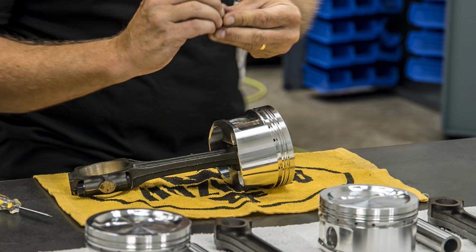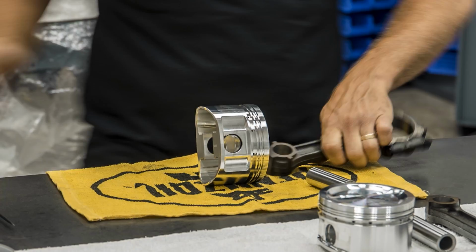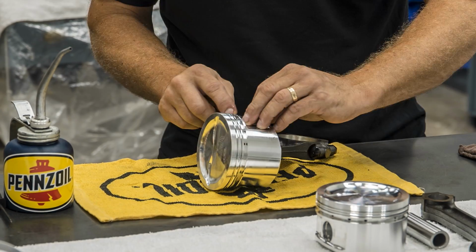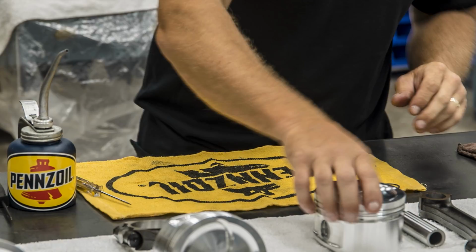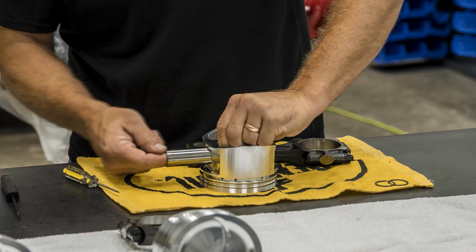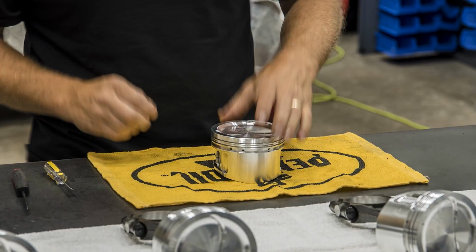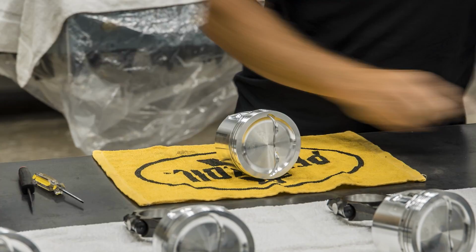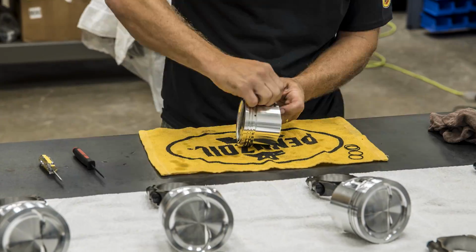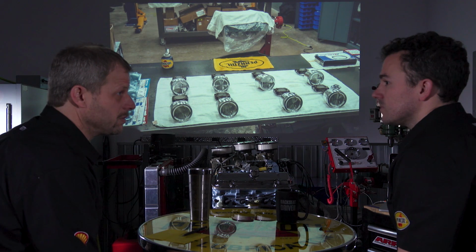And one of the reasons, now there are off-the-shelf pistons available for 389s, without a doubt. I want 9.5 to 1 compression so we can use pump gas and not have a lot of issues relative to spark knock. Factory-wise, these motors would have been closer to 10 to 1. Oh, okay. And with today's unleaded fuel and the ethanol and such, it would have spark knock issues. It would not like it.